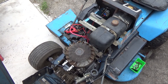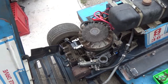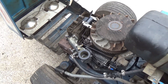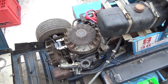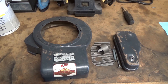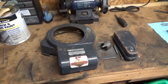The coil swap made the difference — we've got spark all the time now. When I shut off the key switch it did nothing because the kill wire isn't hooked up yet, so I throttled it down manually to shut it off. I'll go ahead and hook up the kill wire, get the shroud back on, then flip it up to inspect the deck. Now that we know it runs, we'll paint the shroud and air box cover with frog tape over the stickers and model number.